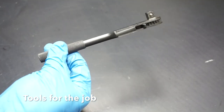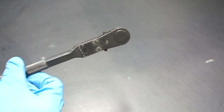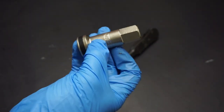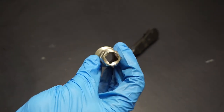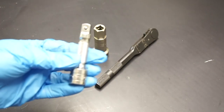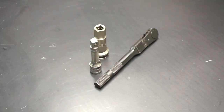The tools you need for this job: a 3/8 inch ratchet — this particular one has a very slim head, which is preferred, but a normal ratchet works too. Next, a 14 millimeter spark plug socket, which is what the manufacturer recommends. And a 3 inch regular extension that fits into your spark plug socket.